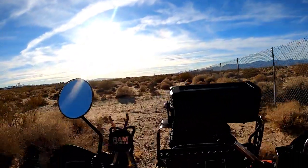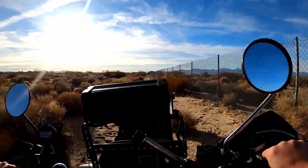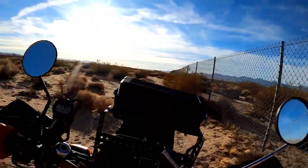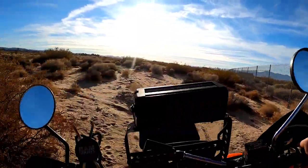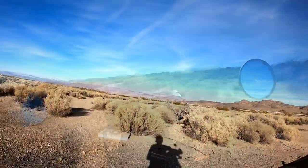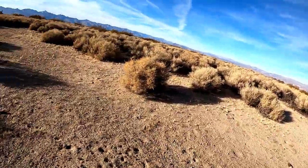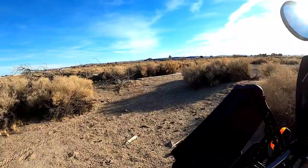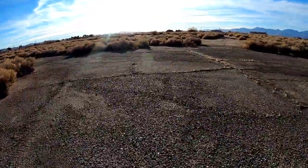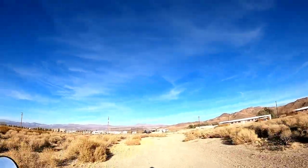I probably went a little overboard with the oil I used. I probably should have used 5 weight because I'm only about 180 pounds, but I used a 15. This track is challenging — the sand's so loose. But I could already notice that my stock springs would just be going crazy on this stuff, and now it's just barely moving, which is nice. Let's hit this kind of hard. Yeah, that was a lot better than stock springs going over that little curb. That little bump would bottom me out sometimes — no problems now.